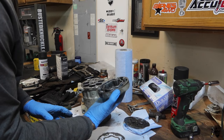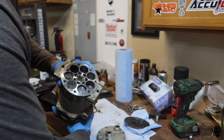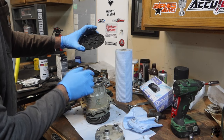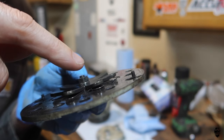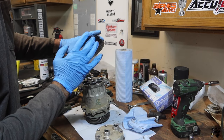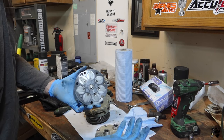For those of you that have not seen the inside of an AC compressor, it has seven pistons in it - you can see them right here. On this side it has a wobble plate, and as it spins it pushes the pistons in a circle around. So as it spins it pushes air through these one-way little valves right here, and it should close and not allow air to go back out through the suction side. But as you can see here, there is a piece of fiber - it looks like a piece of a gasket - holding that one-way flap open. So it is no longer going to be effective and it's going to allow air to escape back out where it's not supposed to. Hopefully if I just pop this piece out and reassemble everything it should work properly - this is about as simple as it gets.